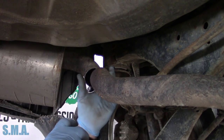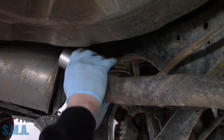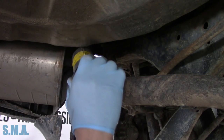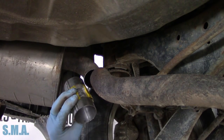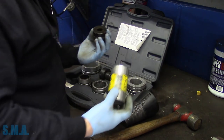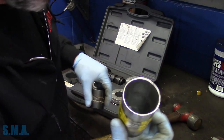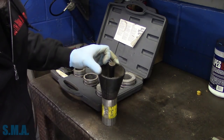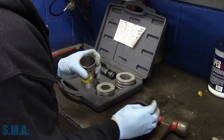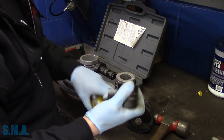We might have to open that up just a whisker, because it barely doesn't fit, particularly on this side. This is a 4-inch connector so it's going to slide a fair amount over each one. I'm going to open this up a bit — the old exhaust stretcher. This adapter usually goes in 2-inch, but because this isn't opened up quite round, it's not going in. I'm going to see if we can round her off a little. The side of the pipe is quite dented. I think we'll be good now — we can push this one in.